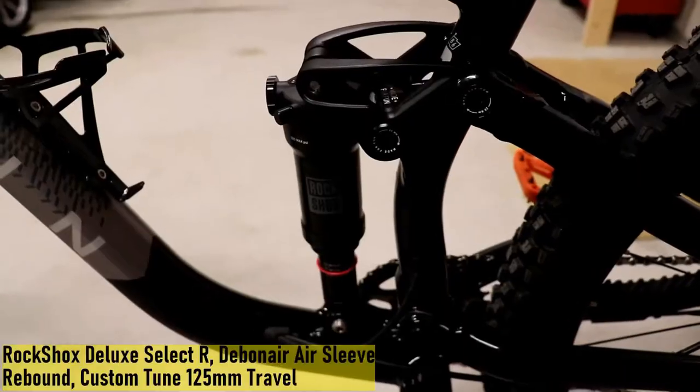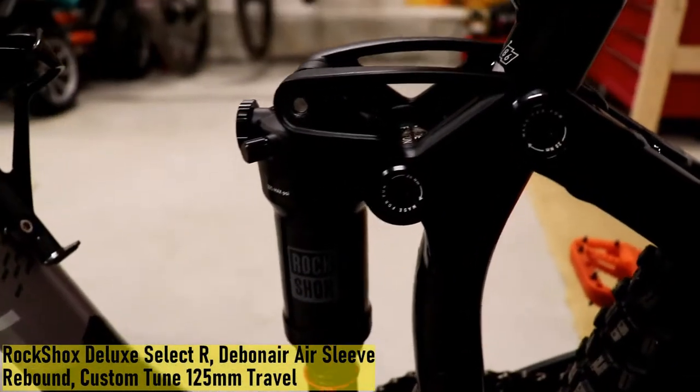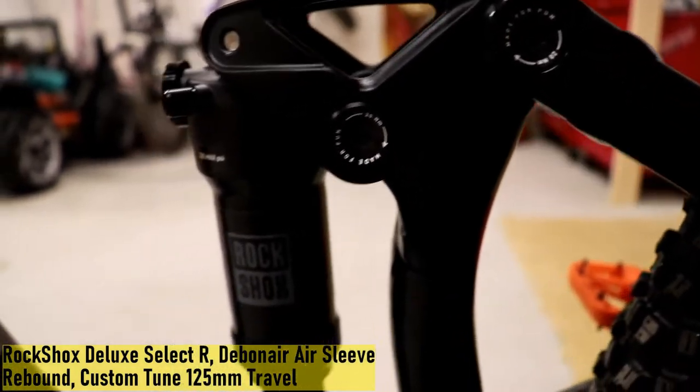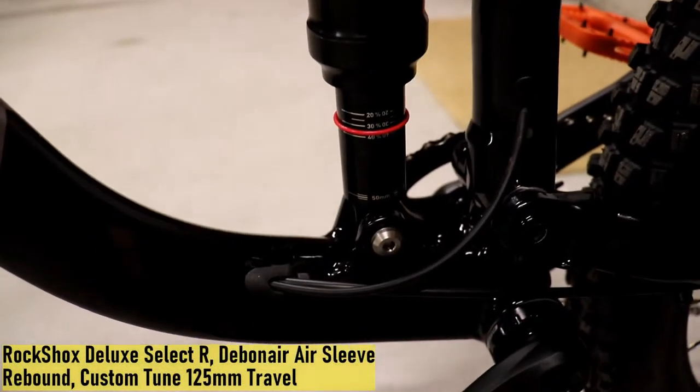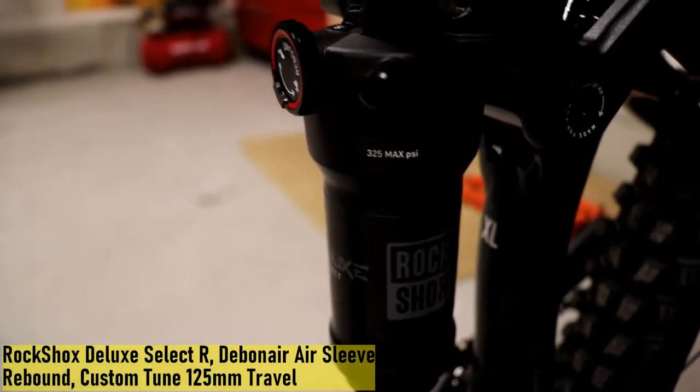And now just to talk a little bit more about that rear suspension, that RockShox in the rear. That is, like I said, a RockShox Deluxe Select R. It has the DebonAir sleeve, rebound adjustment, custom tuned to this frame, 210 by 50 millimeter, M8 by 22.2 millimeter